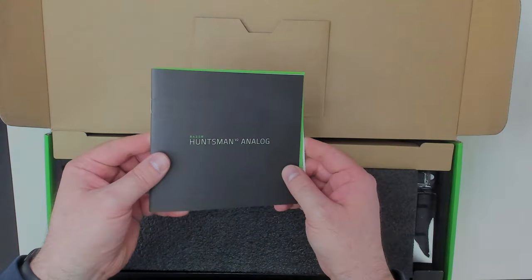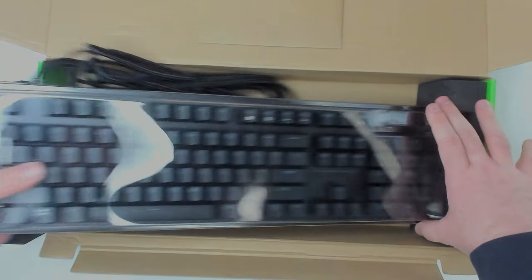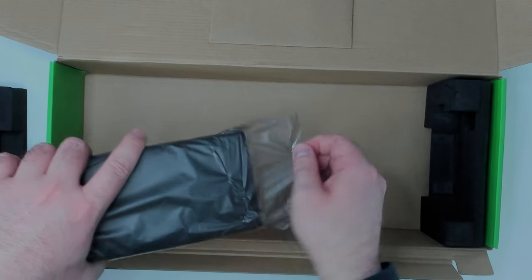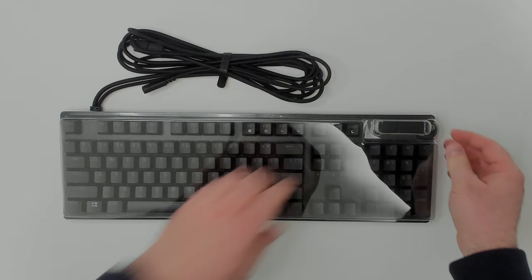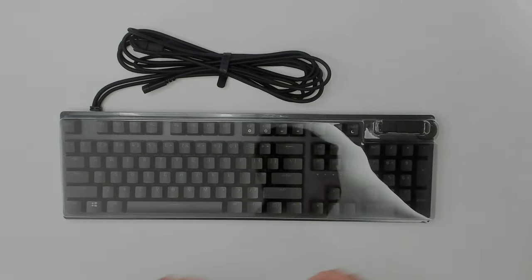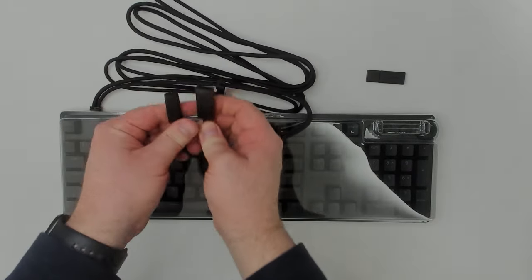As every key has Razer's optical mechanical switches with adjustable actuation between 1.5 millimeters and 3.6 millimeters, giving you the ability to have full analog joystick and trigger control in supported games, along with the ability to have two functions in a single key press. Actuation force varies the deeper you go, between 55 to 75 grams, and dang, do they sound amazing.